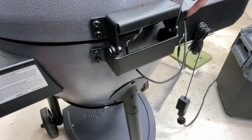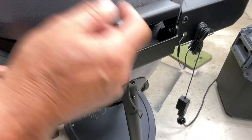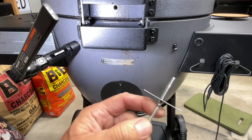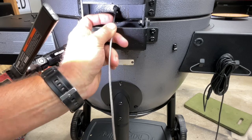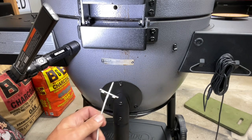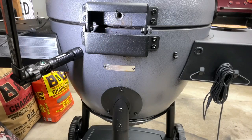This is still the old one. The old one comes through the grommet right there where my finger is and you just pull that out. I got the thumb screw out the other side and with the lid down you can just pull that one out. The new one fits but you can see the difference in lengths — the new one has to be mounted through the inside of the grill. The hole on the inside is big enough for the plug to get through, but on the outside it is not, so we're going to have to enlarge that hole so we can feed this through from the inside. So there's some drilling — a little more complicated than other people online made it sound, but we're going to do it anyway. Half-inch drill bit does the trick.